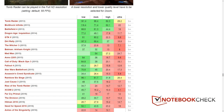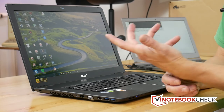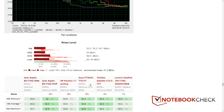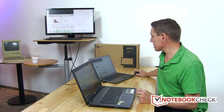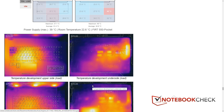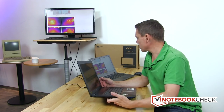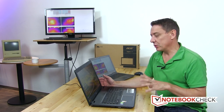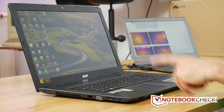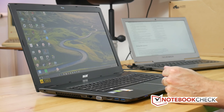Let's get on to heat, noise, and battery. The E5 hasn't generated much heat or noise in normal use. In our test lab, the noise level reached up to 40 dBA — it's not a very noisy device. Looking at the heat map, the maximum is 48°C on the underside and 37.1°C on the top, so in the acceptable area. Just on the left side underneath it's going to get a little warm if you're gaming on your lap, but remember these are extreme load tests — SSD, CPU, and GPU simultaneously — not everyday usage. Loudspeakers are okay.